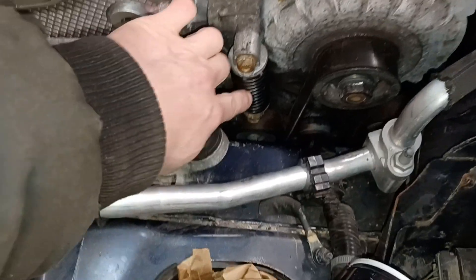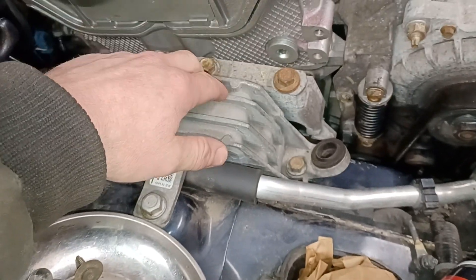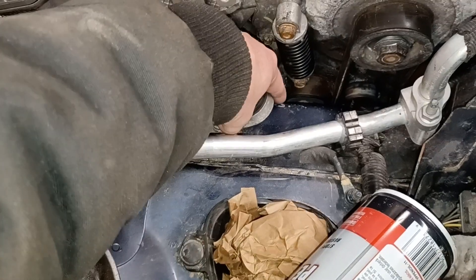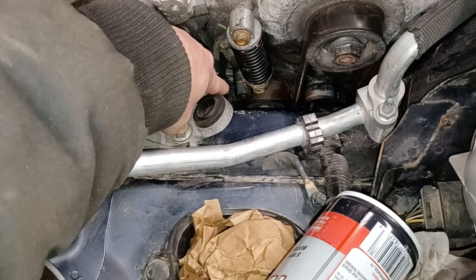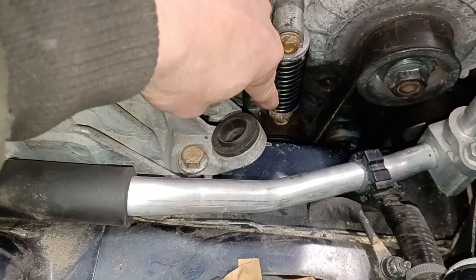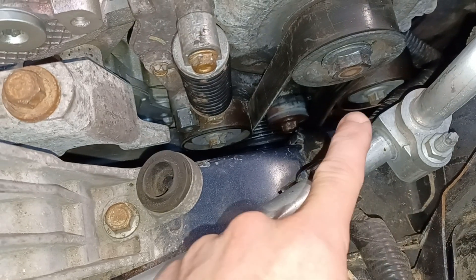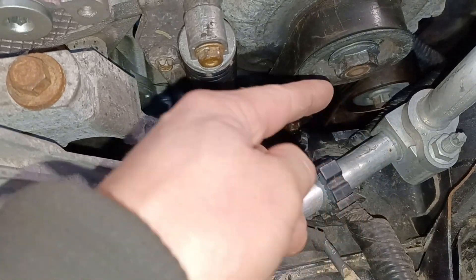What I ended up doing was lifting the engine, unbolting the motor mount, putting a block between the jack and the oil pan, lifting it up, and then with the mount out of the way you can get a big pry bar in here and pry on the 19-millimeter boss. The thing just strips if you try to put a socket on it and turn it — it's not strong enough. There's a little 10-millimeter bolt with a bracket that keeps the tensioner from moving up, which is the direction you need for the belt to loosen. This tensioner assembly has the pivot bolt in the middle, and at the back is a 15-millimeter head that is another tensioner giving you more slack.